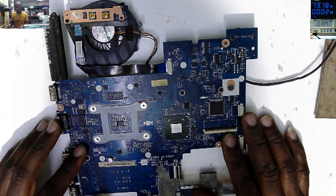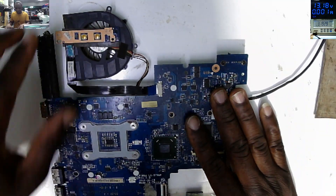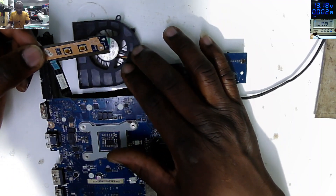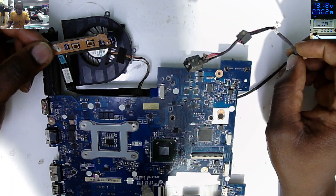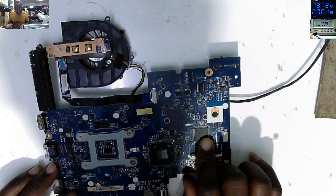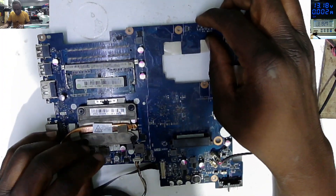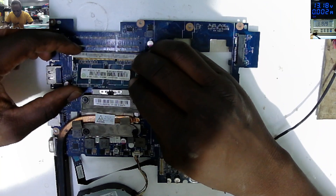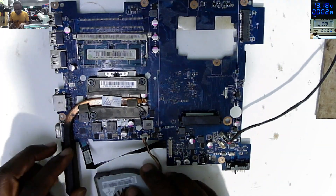So what do we have here - we have the motherboard. That's the switch panel, they brought the fan, and here we have the charging port. PCH, ENE - that's the EC chip microcontroller. On the other side we have RAM, 2GB DDR3. Processor is under the heat sink.